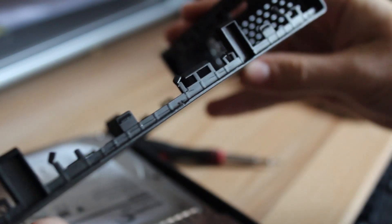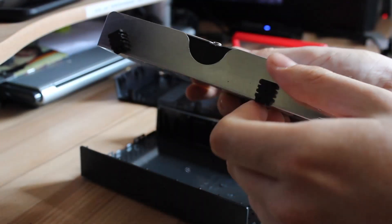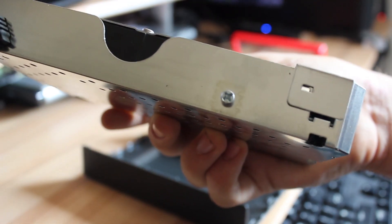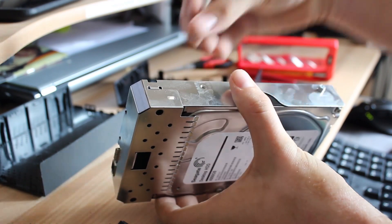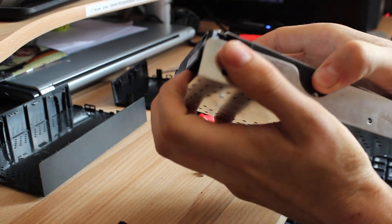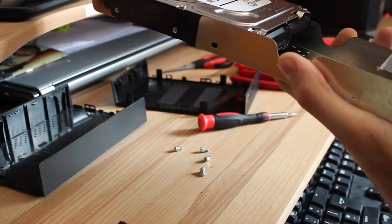As I've said, it's inevitable some of these small plastic clips will snap, but my case enclosure was still resealable and didn't show too much external damage. Finally, you need to disconnect the hard drive from the enclosure. Do this by removing the four rubber feet on the outside of the metal enclosure and then unscrewing the screws underneath them. Then just apply a small bit of force pushing up on the hard drive away from the end with the IO and it should slide straight out.